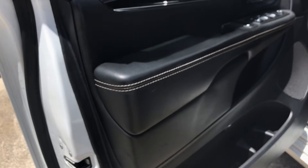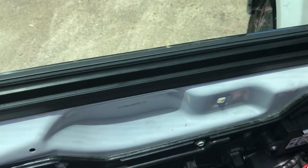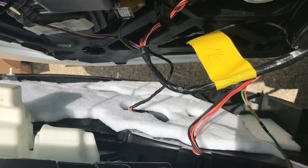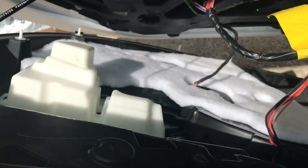You don't want to break the clips because you want to be able to put your door back together. Once you've got them off it's just a matter of pulling the whole door off. There are some pops but that's normal. Pick it up, pull the door straight up, and then you can get to everything a lot easier. When you pull the door off you're going to have a couple of wire connections — remove them first: they attach down at the light and at the door opener and window openers. Once you get those off, including the handle release cord, you'll be able to set the door aside.